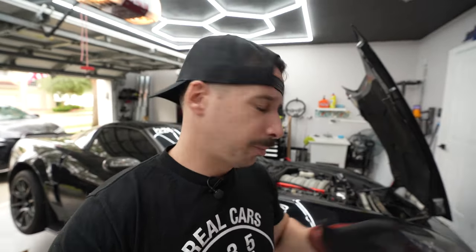So there's clearly quite a bit of damage on the lower radiator support. The lower tab for the radiator that seats on the lower radiator support on the passenger side has broken. I don't think it's broken to the point where the radiator is compromised, but the mounting is. So I'm gonna start with taking this car further apart. I'm gonna take the wheels off the car, I'm gonna take the front bumper off the car, to give myself some more clearance, some more area to work with, and then do this slowly and meticulously to make sure anything's not being overlooked.